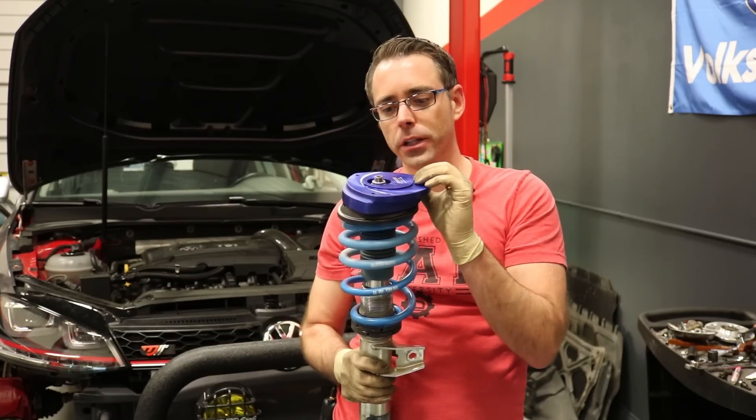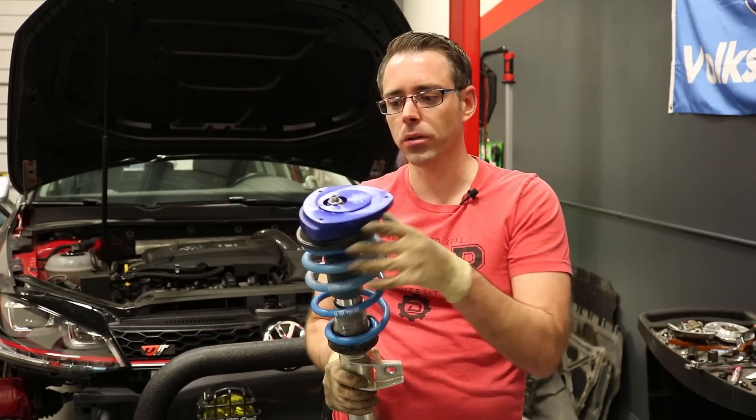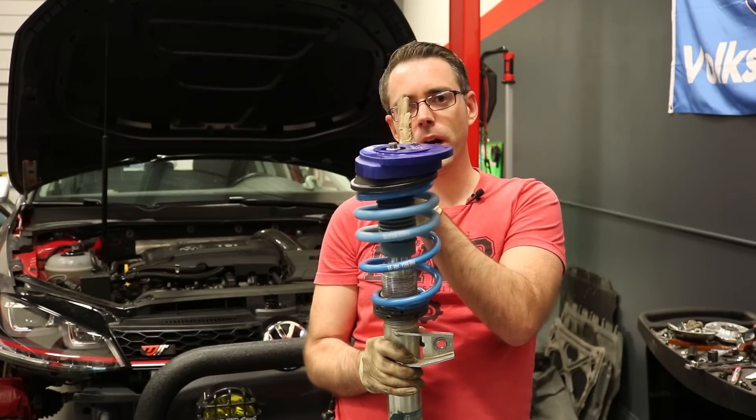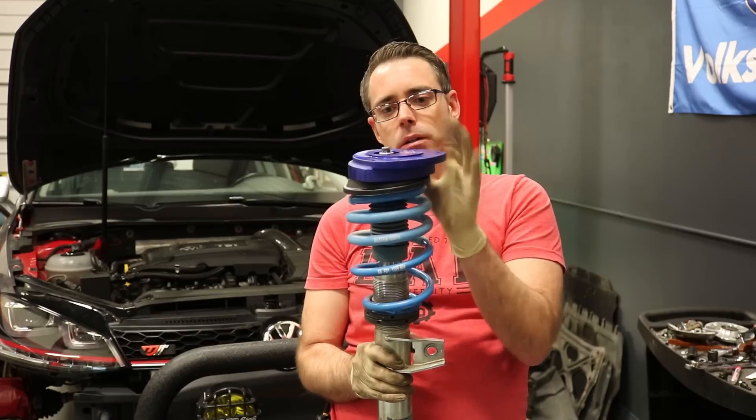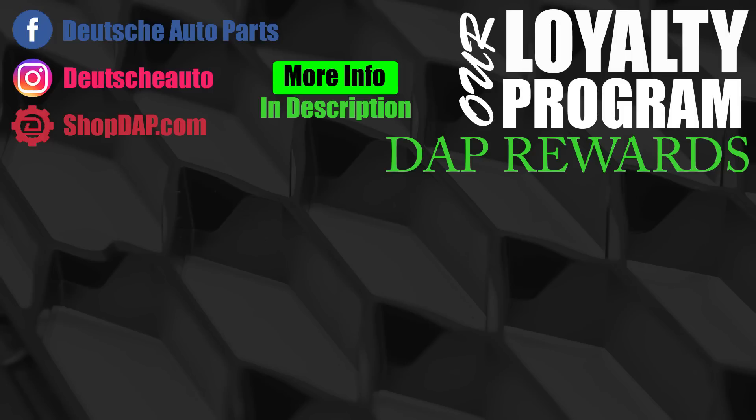When reinstalling, make sure you have the correct orientation — the SuperPro label should face towards the outside of the vehicle. For negative camber, you want the front struts leading in, so orient them further in towards the vehicle. Thanks for watching — if you liked this video, give it a thumbs up, subscribe for more, and check the links to everything we talked about in the description below.